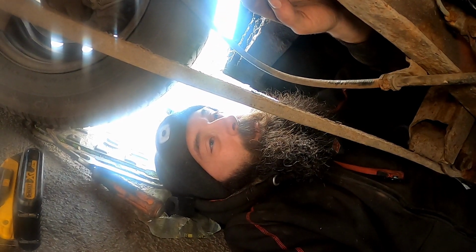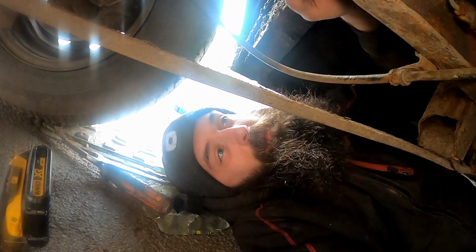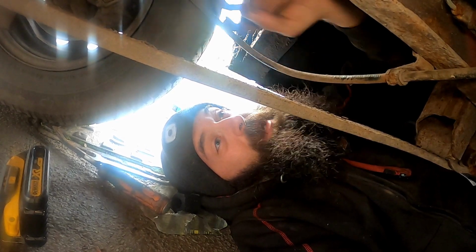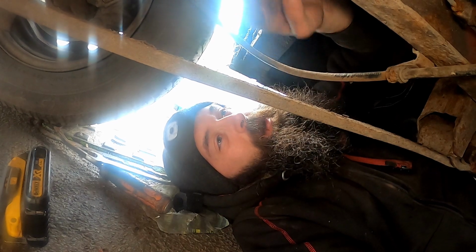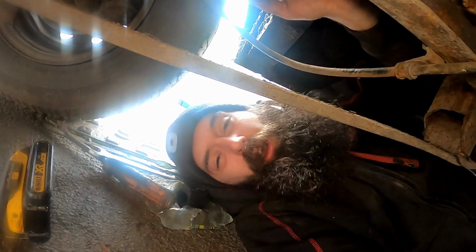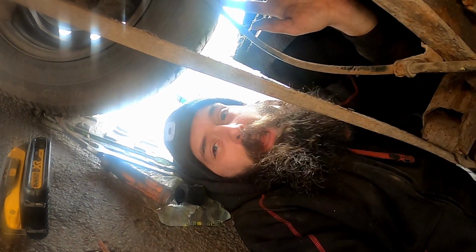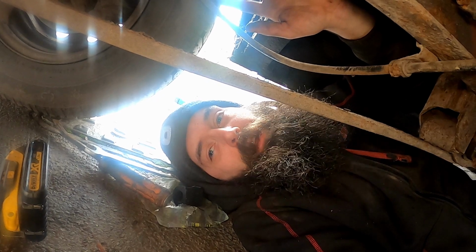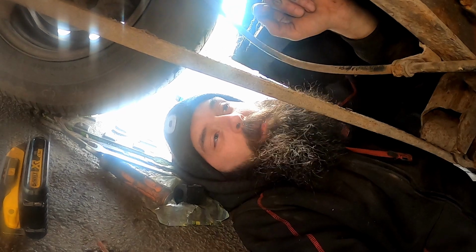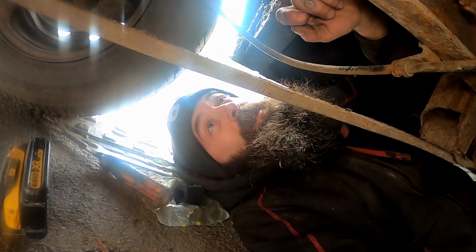It lets the bush sit in its natural position as if you were driving along, you know what I mean? So if you have it jacked up and you push that bush in and you tighten it down, when the van goes down, it could potentially twist the rubber, and yeah, it's just nice common practice. It's good work etiquette. I can't really say it. Etiquette. Yeah, we'll go with that. Right, onto the other side, and then hopefully we can get onto these handbrake cables.